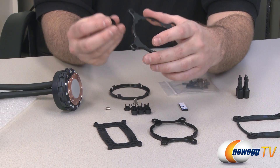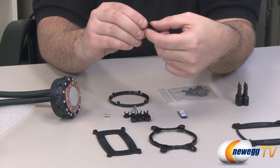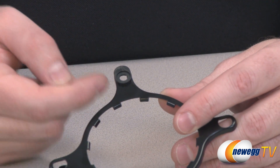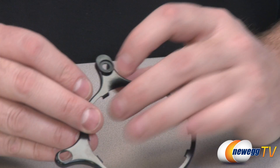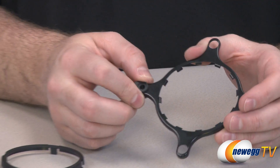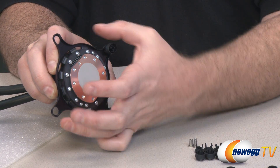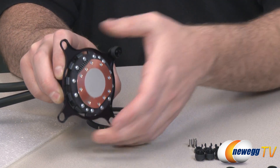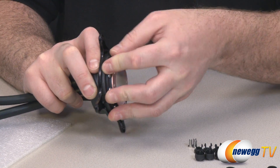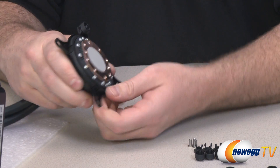Next, take the little plastic clips — one goes on the bottom of the bracket and one goes on the top. You can twist it according to the manual to accurately fit the various Intel sockets. For 1155 you want the inner position. Take the back clip, switch it so the gap is on the inside, snap it into place, and you're set. Do that with all four corners, then take the ring and attach it to the cold plate and pump itself. Make sure you can rotate it to the position you want so your tubes will be in the right orientation on the motherboard. Then clip in the last plastic ring — it has four clips on either side that hold everything together securely.